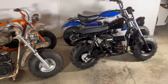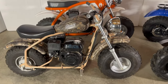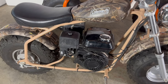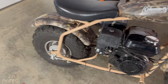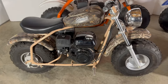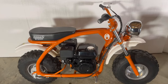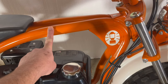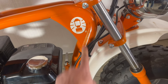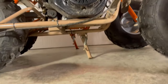Most of my interest and knowledge is in these 200cc frames. These are by far the top two sellers: this is the Coleman CT200EX, and that's the Coleman BT200X. These have the exact same engine, drivetrain, brakes, and steering column. The CT is nice for roads and smooth trails because it has a lighter, weaker frame, and it has a nice carry compartment. The BT is about five pounds heavier and has tubing which is three times stronger than the CT, and this welded gusset right here which helps where the frames usually break on the CT. The BT sits about six or seven inches taller, but the ground clearance is the same on both bikes.